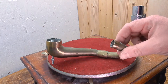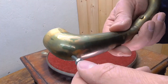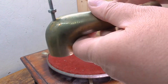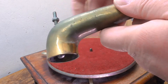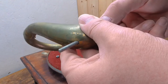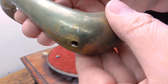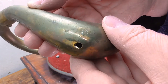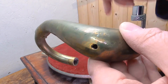I've taken the sound box off just to give myself a bit more space to work. Quite how this arrangement is supposed to work, I don't know. I almost wonder if the brass bit is threaded, because this screw doesn't seem to go up and down very easily at all. So I'm going to take this nut off here and unscrew this long screw as well. So there are screw threads in there after all, and although that's not a great design, it does explain how the tone arm is basically sitting up on the screw even though there's not a nut or anything underneath it.